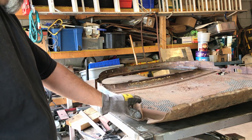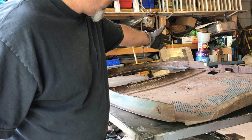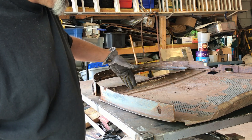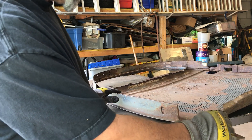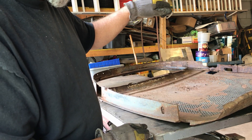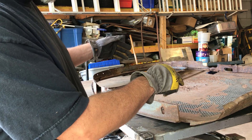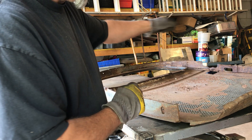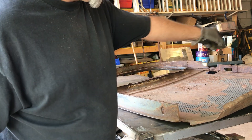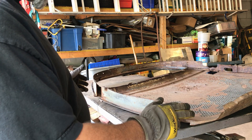Once I have that plate in the right shape and size, I will then be making a frame with angle iron that will go from that plate across that way, down that side of the door, back up this side of the door, to the bottom side of that plate. Still not attaching it to the door at this point. So when it's at the right sort of shape — it doesn't have to be exact — I can take that frame off, put it onto the hinges in the car, make sure it's lining up properly, then slip the door skin over that frame. When I'm happy with where it closes into the car, I'll tack it all the way around, then take it off and weld it up properly. There will be more structure going inside — maybe a steel tube going diagonally down to give it more strength and a bit of safety. But for now, let's get this plate cut and the frame made.